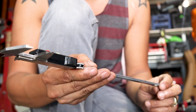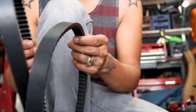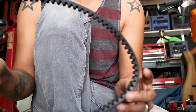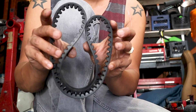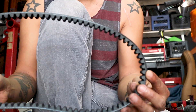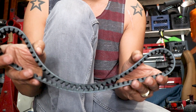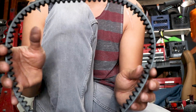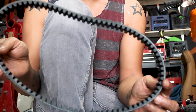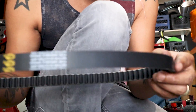But it's a little wider and it'll be able to push those plates further apart and ride up higher because it's longer. So the old 835 belt is shorter and skinnier — this is your takeoff belt, your torque belt. If you live in a mountainous, hilly area this is probably the belt you want. If you live somewhere flat like Houston, then an 842 is probably what you want. Now for the ruckus, the Pellini belt versus the Gates or the stock belt — the stock belt is wider and longer than the Pellini so you really got to check on that.